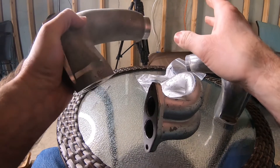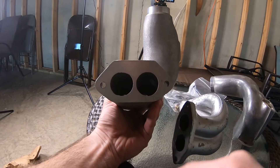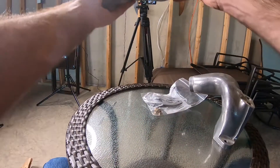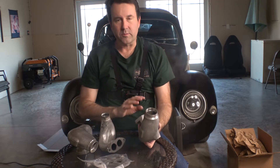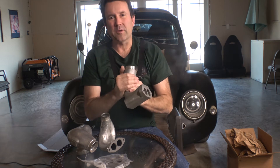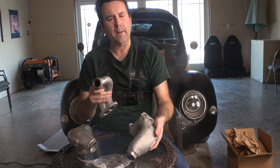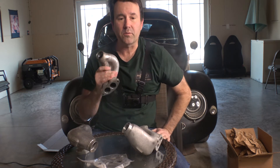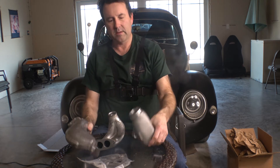The other good thing about these is they're based on their big beefy style manifolds and there is a lot of room for porting, compared to something like this — just look at the difference. In the heads I'm running right now there's really no need for that yet, but hint on what's to come. These are advertised as flowing 50 percent more than stock — I'd have to reread whether that's compared to a stock end casting or their previous casting, but 50 percent more flow is incredible. I'm really excited to try them out.